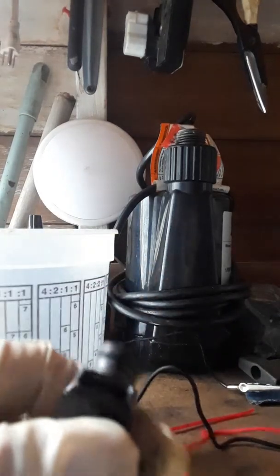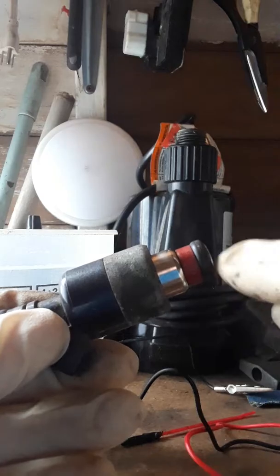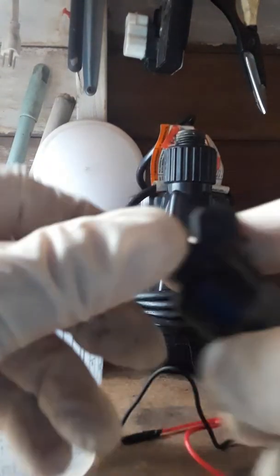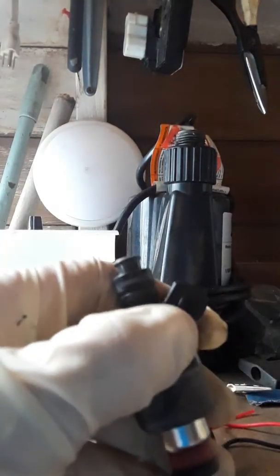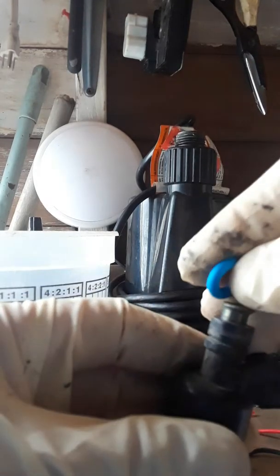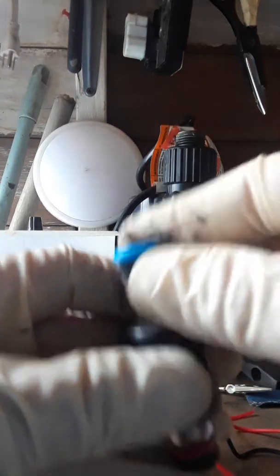All right, here's the fuel injector. You want to change these O-rings. There are ones on the bottom right there, and ones on the top. So you want to pop off that O-ring right there. And I got a couple of new O-rings right here. I'm going to put that O-ring on the top there. And then you got another O-ring on the bottom. Like I said, take this part off.